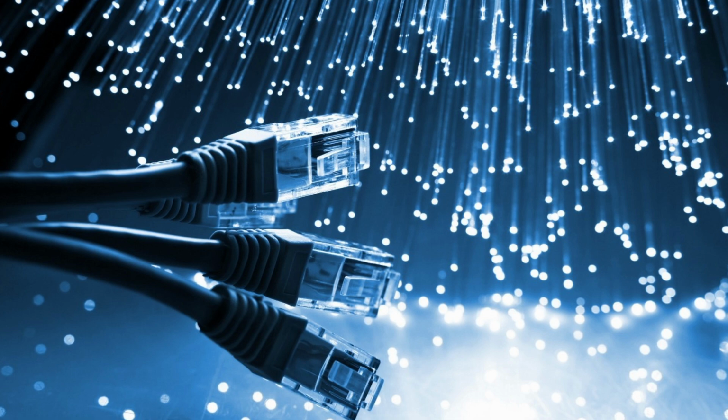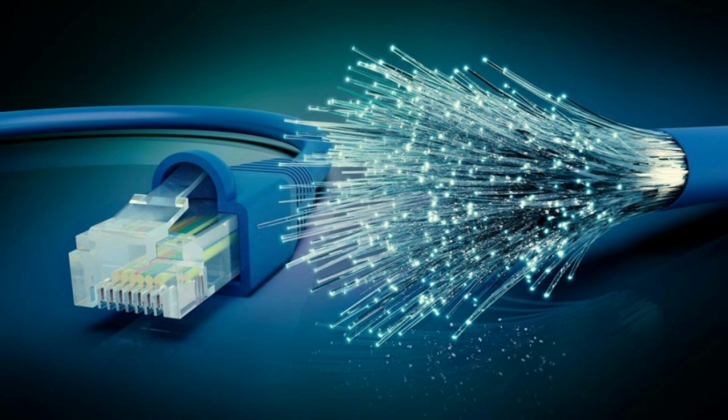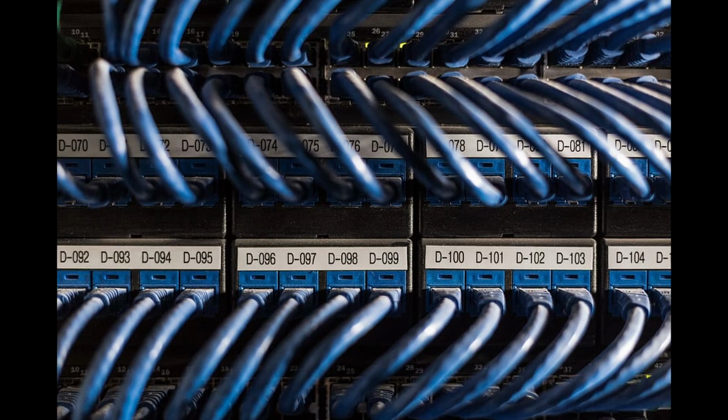So what are the benefits of having 10 gigabit? Well, higher bandwidth, so your data transfer speeds are faster, your latency is lower, your cabling options are a little more open where you can go with fiber optic or with twisted pair copper cables, mainly with the newer technologies with the Cat 7, Cat 6 cables. Scalability for future-proofing. The best thing about 10 gig is it's backward compatible with 1 gigabit networks. So you can easily plug in anything that is older and still have it working, and everything will be the same as it was before. You won't even know the difference. And other than that, it's just way more efficient, reduces bottlenecks of the network, and transfers data a lot faster to and from your computer.